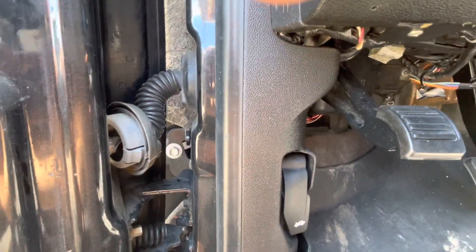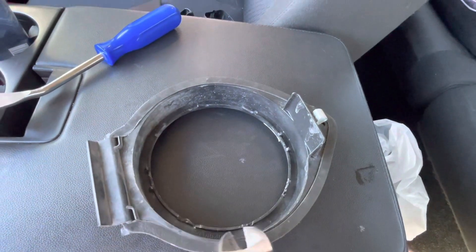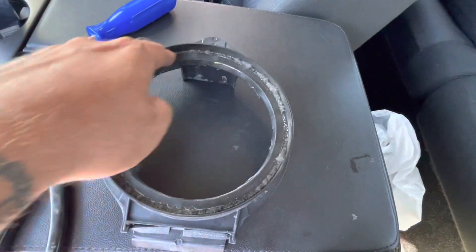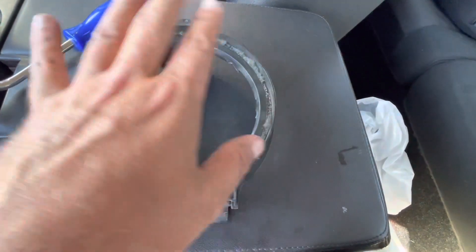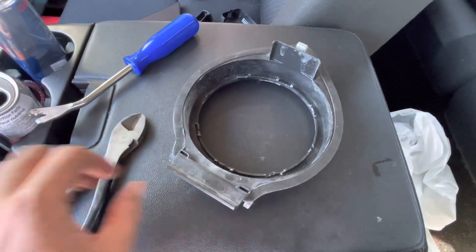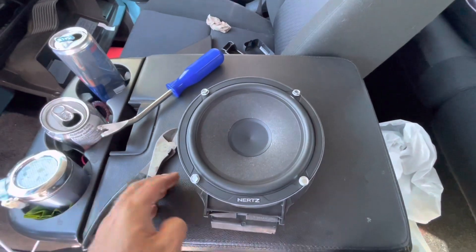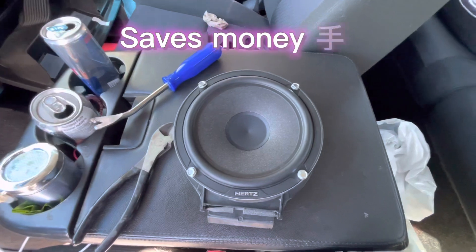Here's the bracket — I took wire cutters and basically cut all the plastic basket out. It's a plastic basket, but we're going to move up to metal screws. In doing so, you can now fit the six and a half inch Hertz driver into it. Just need some tough self-tapping screws. I ripped the foam out here as well — that was where the surround of the driver was attached — and cut that out with an Exacto blade. That's how you make your own door speaker adapter without buying a kit, though depending on your driver you may want to just get a door kit.